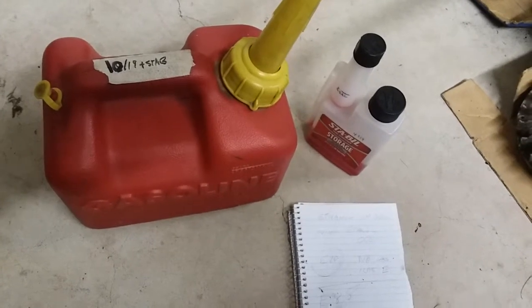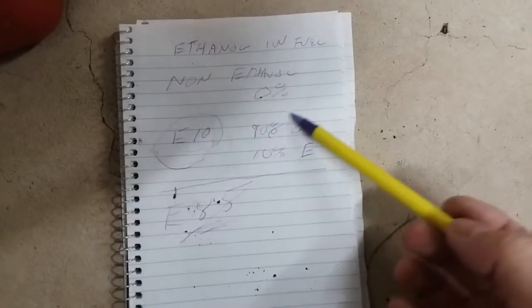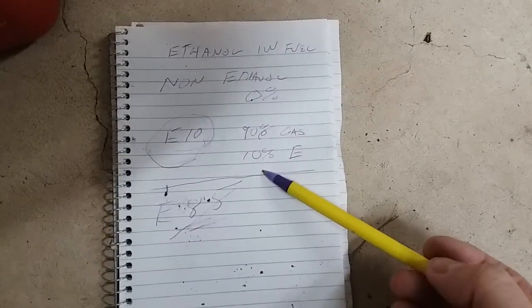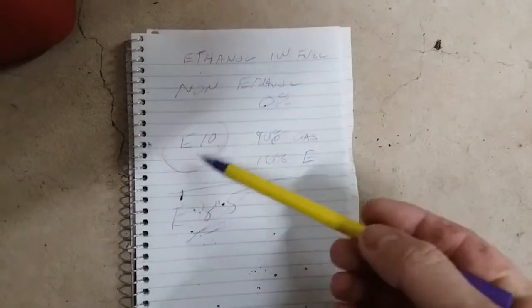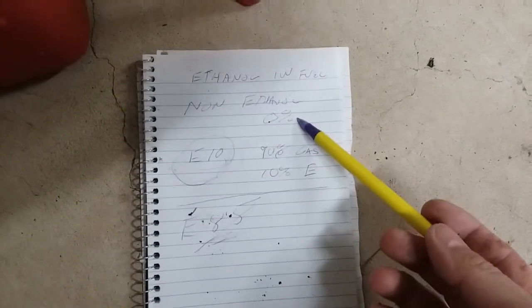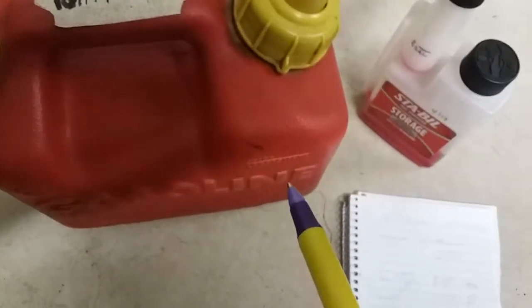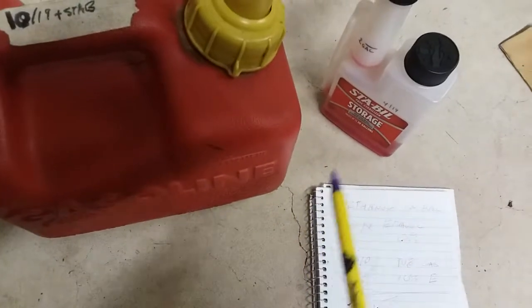By doing that, you should eliminate any kind of ethanol problems. The fuel at 10% is blended in with the gasoline. As it comes out of the pump, depending on the delivery — if the station got a 10% ethanol load and then got a non-ethanol delivery — maybe it's only 5%, but at max 10%. This 10% ethanol really doesn't separate until it gets humidity and attracts water into the fuel. That's where you get phase separation — you'd actually see another layer at the bottom. In that other video I showed how you could recover the fuel still in there and separate out that ethanol-water mixture.